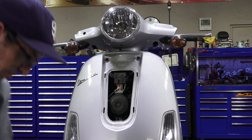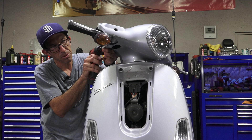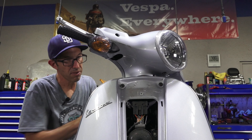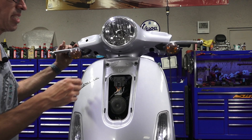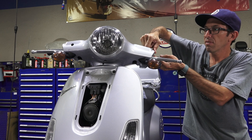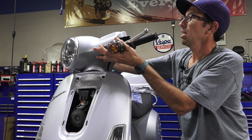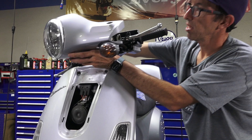From the back side, there are two screws on each side — that pretty much covers the fasteners that hold the front section of the handlebars. Go ahead and remove the front half of the handlebar covers. Get your finger in here — there are tabs. On this older scooter, one of the tabs is broken, which is common for an older scooter, just due to the age of the plastic. I kind of pull the handlebar covers away — it also hooks into the top.